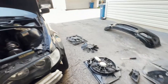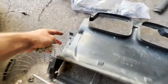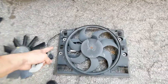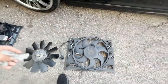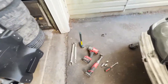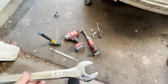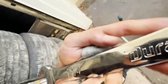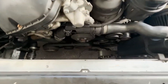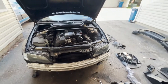Now it's gonna be revving a lot more freely and I feel like there's gonna be way more airflow since we removed that front fan. It's just two push pins holding it here and two push pins holding it there. To remove this it's four 13-millimeter bolts holding it, and just a regular plug. To get the fan clutch out you're gonna need a special tool to hold the two fan bolts — the wrench that came with the kit wasn't the correct size, so I found online that a one-and-one-quarter inch from AutoZone will remove the fan clutch bolt. Let's slide this new fan in, connect it up, start buttoning up the front end.